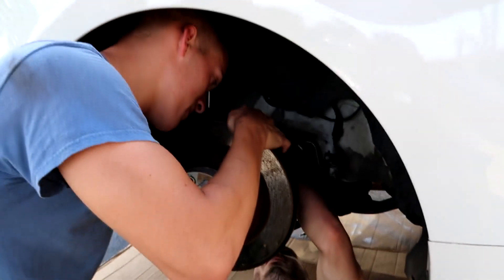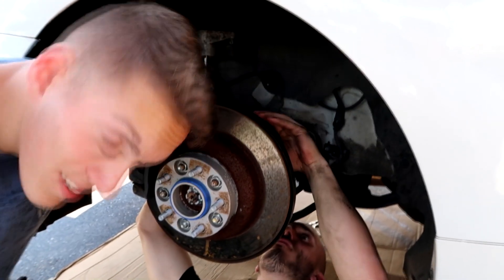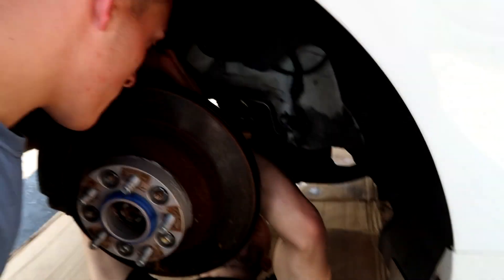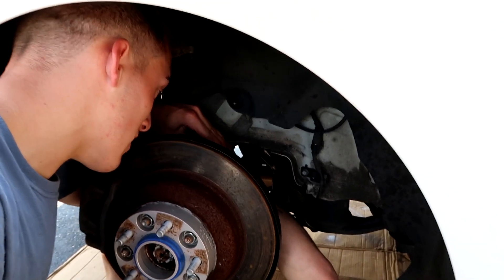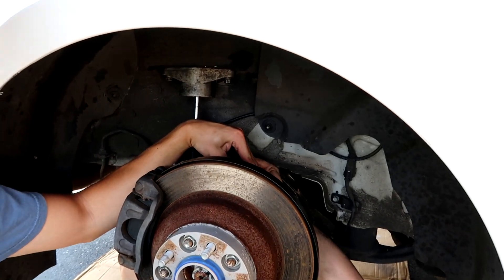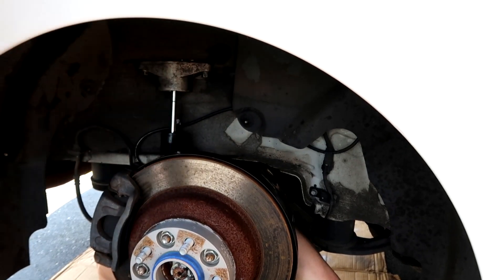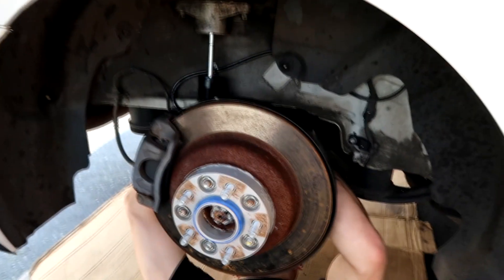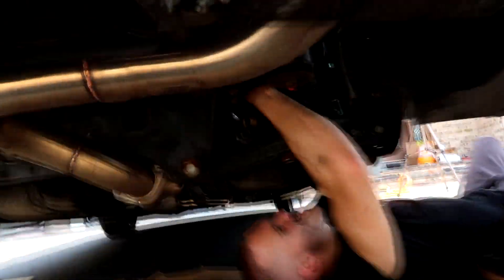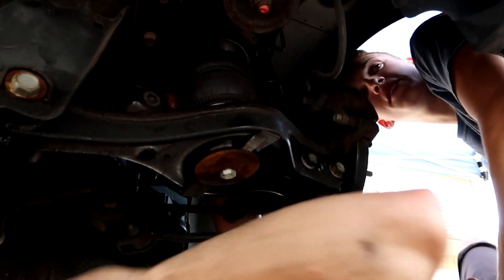Installing the new camber arm — checking where the rotor is now compared to how deep it'll sit. The back part goes in first. That's a lot of camber — the level app reads negative five right now. The front was negative two from the top hat. I got lower control arms for the front. Installing is pretty much the same process as removal but now with the new piece.